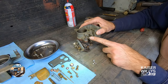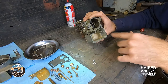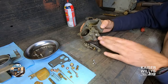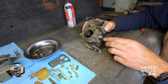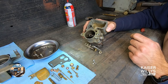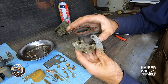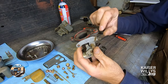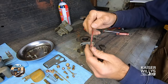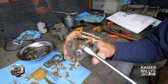The kit did not come with this plug, so I'm not going to remove it, but I can spray through here and that passage comes down to the bottom of the bowl. We'll ensure with compressed air and some carb cleaner that it's clear. That's why we check - you can order these separately through Carter, but this probably isn't a necessary one since the master kit didn't come with that plug. Don't take that one out or you won't have anything to replace it with. For the cast iron base, there's really not a whole lot going on here. We already counted the turns on the idle pilot air screw. We'll remove the gaskets - there's a spacer and two gaskets - and set those to the side.